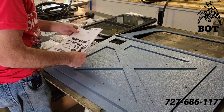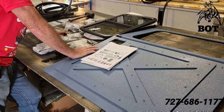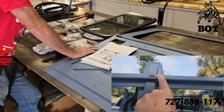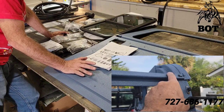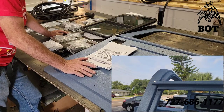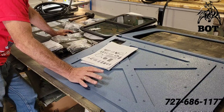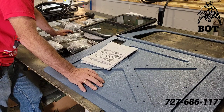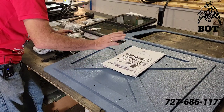As you all well know, all these trucks are a little bit different. They're all going to have different things that make it easier or more difficult, including the side rails on the trucks, which stick out too far on a number of trucks. On my truck I did change the side rails. Not everybody's going to want to do that, but if you don't, you're really not going to get a good seal with these doors or your soft doors, X doors, or any kind of doors. You're going to get a better fit and less water coming into your truck.